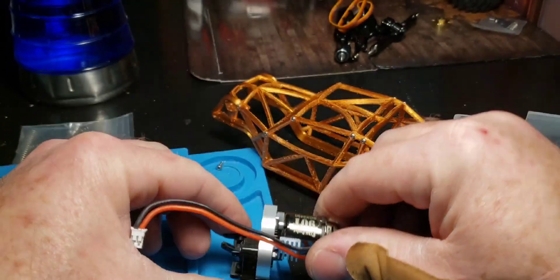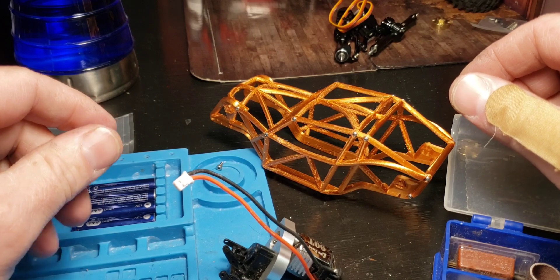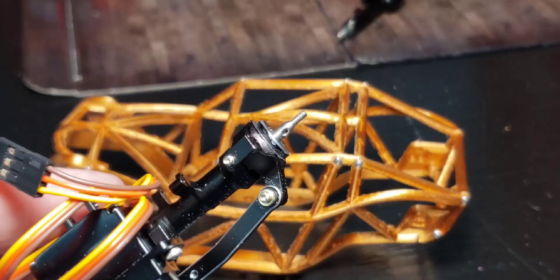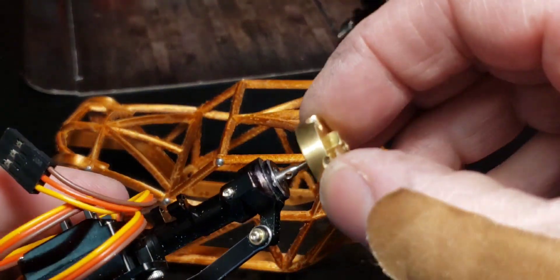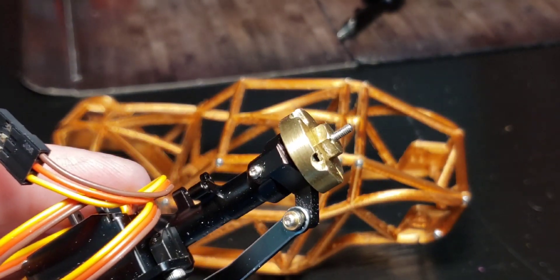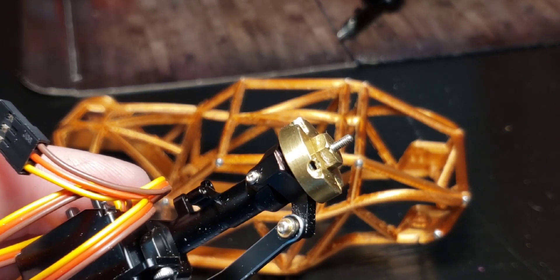There's no way around it — if I have to shave off about three millimeters from the rear drive shaft, I can do that. The front one still has enough length on it that it'll have no problem locking in properly. I had to do quite a bit of grinding on that to make this fit properly, but I put some black Sharpie on it so you can't tell. I still get full thread penetration on that, so that should be a good fix.